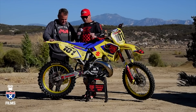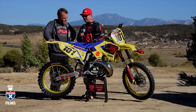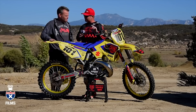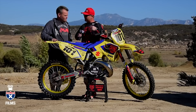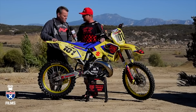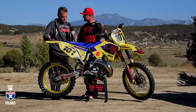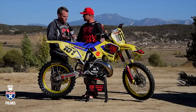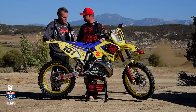We updated a lot of things on this. This didn't have a lot of time on it and wasn't too beat up, but just being this old, it's important — those cables can, over time, if they get moisture in them, become a little sticky. So it's important to replace those on anything this old. When something's 15 years old, there's some stuff that's just old, so it's good to go through it, especially the carburetor hoses and things like that. We rebuilt all that stuff.